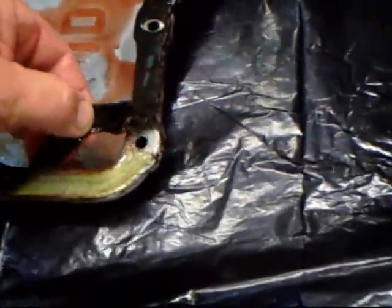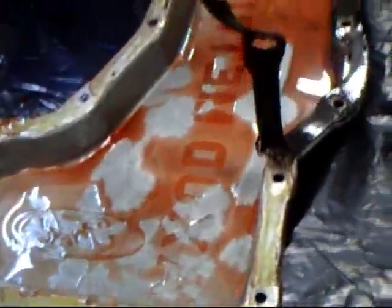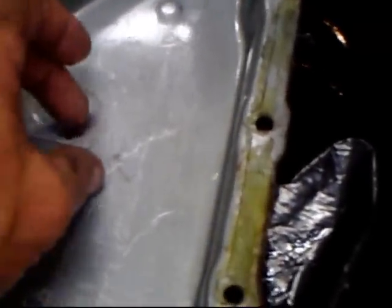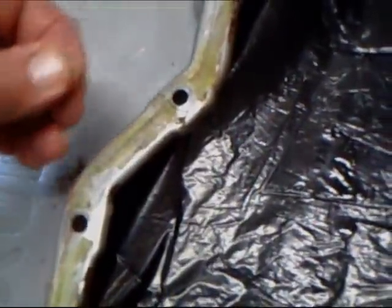Let's get this old gasket off and the new one on. Oh, I see what's wrong here. Somebody did put sealant on here, and it says specifically not to use any sealant on this gasket. I'm still working on getting the sealant off. I did clean out the inside of the pan and I ran across quite a few pieces of this silicone rubber — whoever put this on there was not supposed to do that. It's just coming off inside, which is really bad for the transmission. You should never do that.